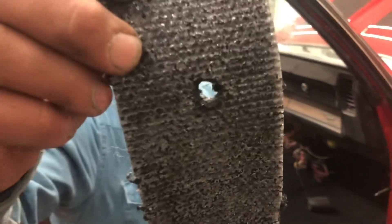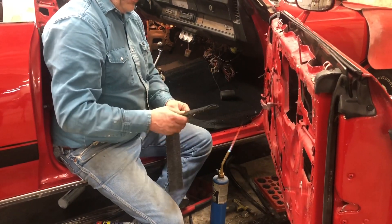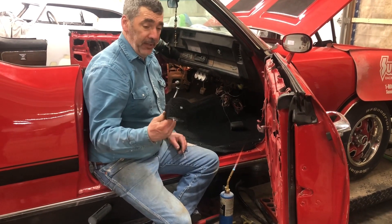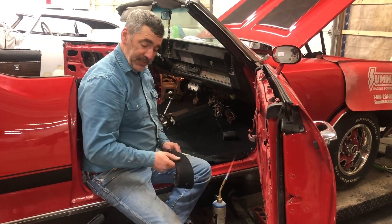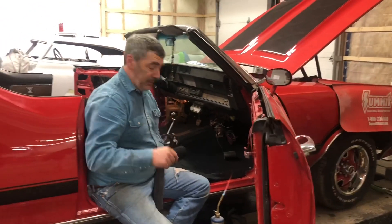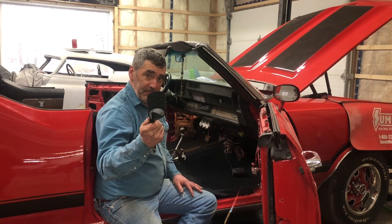That's the carpet right there that I drilled a hole in — a piece of scrap. Look at that burned hole versus the drilled hole. If you have a drilled hole you're gonna end up catching the carpet and sucking it into your drill bit and you're gonna say some bad words. The burned hole prevents that and the finished product is way nicer too. Maybe I'm the only one that didn't know this before, but I've been doing it for years now after drilling carpets for years before that and swearing every time. Shift boots with small screws, seats with a bigger punch, the dimmer switch — I burnt through for that. I just wallowed the punch around until I had the hole big enough. Whatever works for what you're doing.